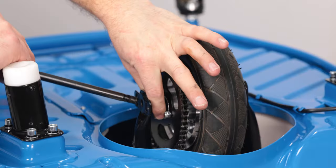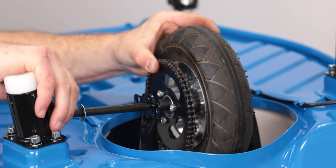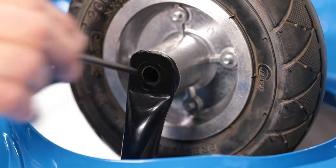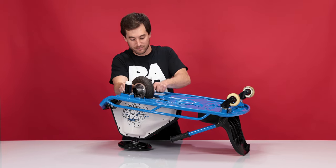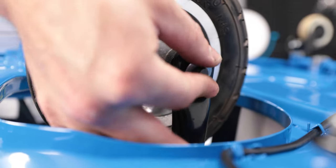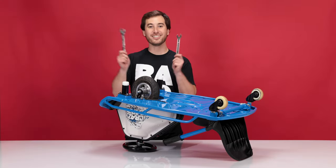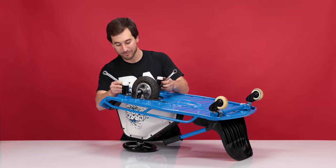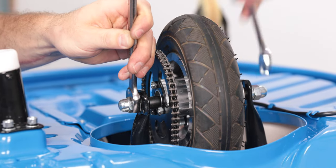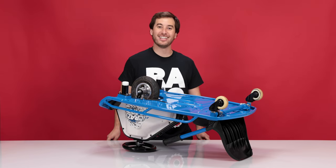Take your axle and slide it through the fork and the wheel. There's also a spacer inside the wheel — a trick to get the axle to slide through it is to take your Allen wrench or screwdriver, slide it through from the other side of the wheel, and adjust that spacer into position. This part's a little tricky, but keep at it and don't give up. Now put on the flat washer, followed by the lock washer, followed by the axle nut. Using your two 16 millimeter open-end wrenches, tighten down that axle — hold from one side, tighten from the other. With the axle tight, that concludes step five: installing your new wheel and new chain.